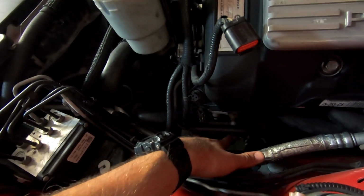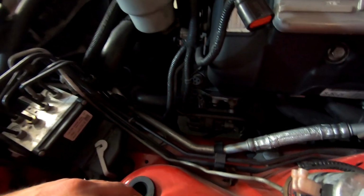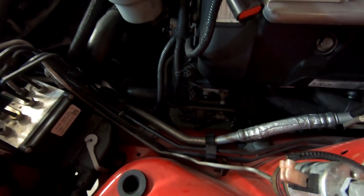And the thing is with these, once you pull them out, they can't actually come off. So when you reinstall it, you have to make sure to insert these first before sliding the alternator up in here, or you're not gonna get it out. So what I'm gonna do is undo them. They're just gonna rest against the body, and then we'll go underneath. Also, a little dark, but there's a pulley right in here. That is the idler. It's a 15.